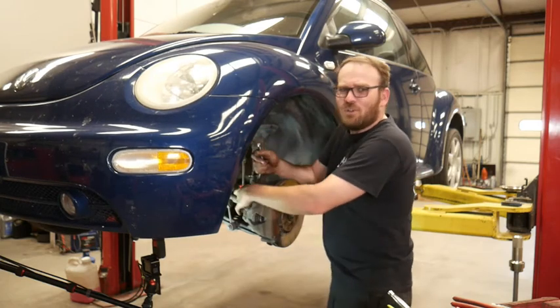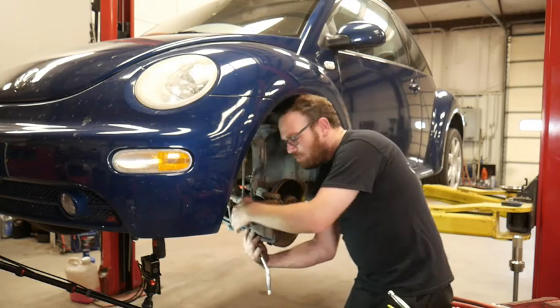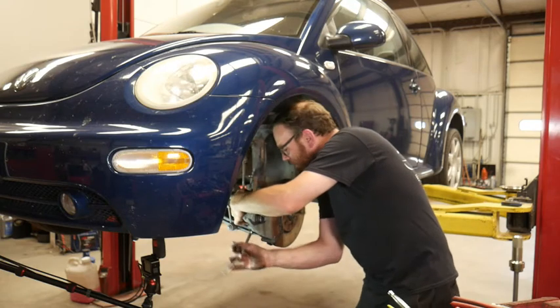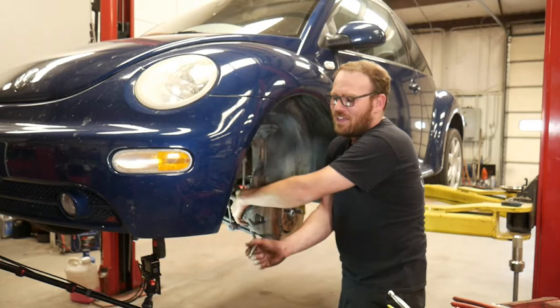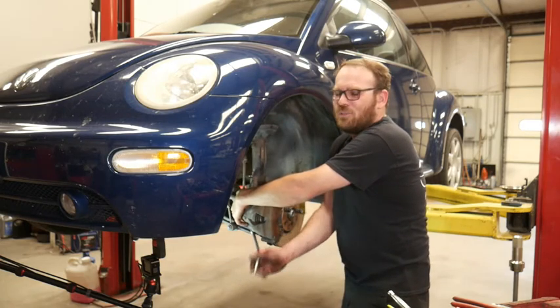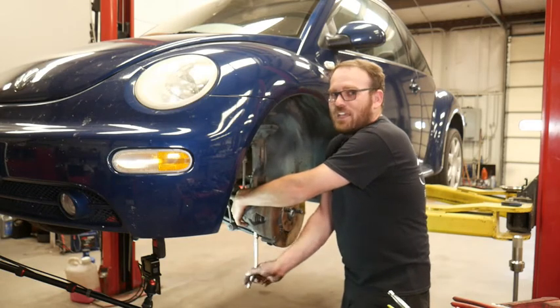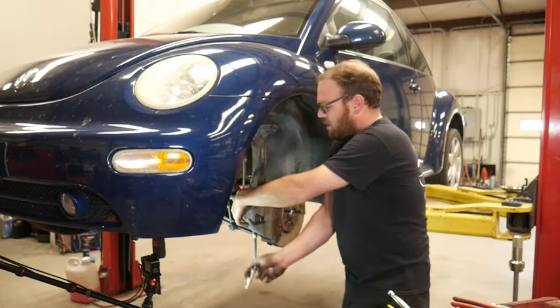I kind of wish it was the Toyota Highlander, because that one's easy to change out, but it was on my Toyota pickup and I have to pull the front diff to get the oil pan off. I ordered a single oversized plug. I'm hoping that'll go in there and snug up for now, because eventually I'll have to build the motor. It's got 300,000 miles on it. But in the meantime, hoping the oversized plug will fit. Pico, cool, way to go.